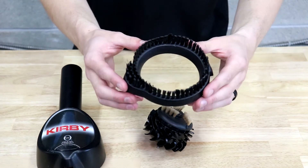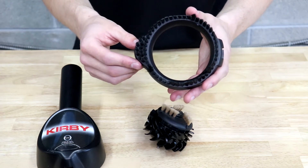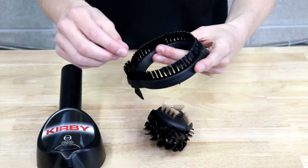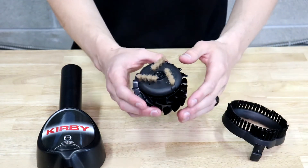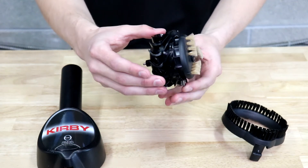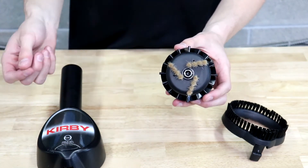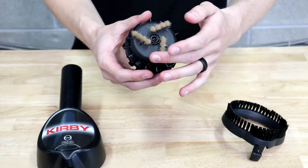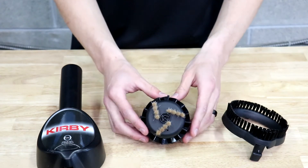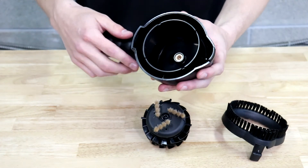For the top part or the top bristles you can either run this through a wire wheel, or if you have an air compressor or a can of air you can spray all the dirt, debris, and hair out and just pick the hair off. For the spinning brush or turbine there's usually going to be dirt and hair caked on the middle part, so that's when the razor blade comes in handy — you can cut the hair away and pull it apart. For the main body you can usually just wipe the inside out because it does get pretty dirty.